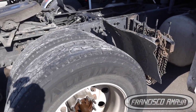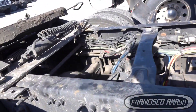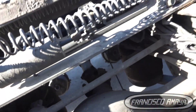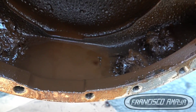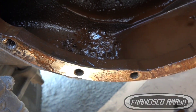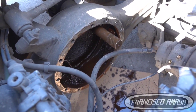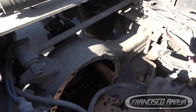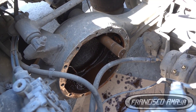The truck was making that sound while driving, which you can hear. The problem was here — the differential needed to be removed. We can see all the debris and metal chafing the guard; the differential is completely destroyed. This happened because the differential ran with very low oil for a long time, and that caused the problem.